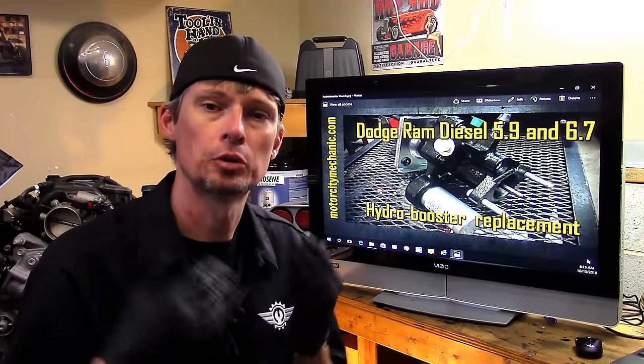The vacuum is created because there is a throttle plate, so they can use vacuum under certain situations to make that power brake booster work properly. It presses on the rod for the master cylinder — it's a mechanical advantage. Diesels are different. Diesels do not have throttle plates so they do not create vacuum the same way a gas engine does.